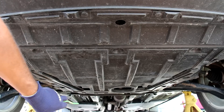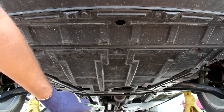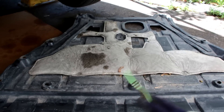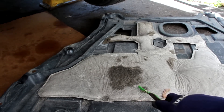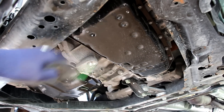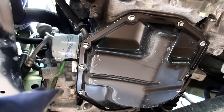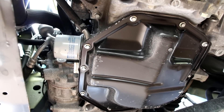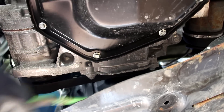Further behind, there are two parts uncovered, and the back section is covered — not sure why they didn't cover the whole thing. The exhaust is also completely uncovered, but this is an economy SUV so you can tell where they've cut corners. One downside is you have to remove the whole cover to change your oil, which means the clips tend to break away quickly, and you also can't tell if you have an oil leak. With the cover removed, changing oil is pretty easy — there's a spin-on style canister oil filter and the drain plug is located over here. The oil pan is straightforward to access, and the upper oil pan integrates the oil pump on the timing side of the engine.